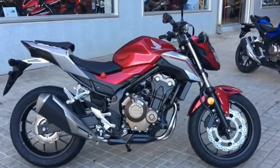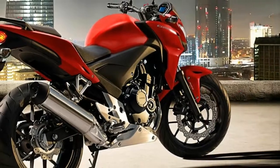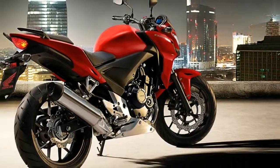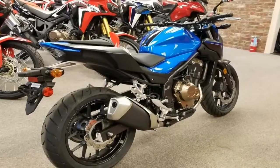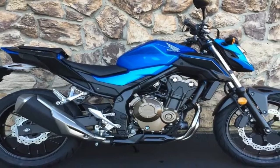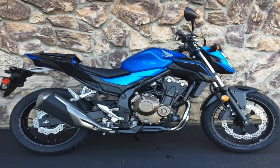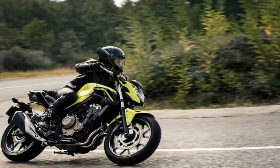A diamond type frame made up of 35mm steel tubing serves as the mostly visible skeleton for the F. The steering head comes set for 25.5 degrees of rake with 4.01 inches of trail on the 55.5 inch wheelbase — numbers that drain just a skosh of agility for a bit of stability, but doesn't turn cornering into a wrestling match by any means.